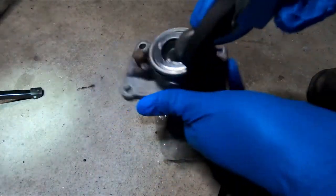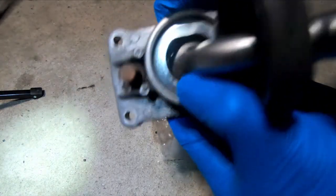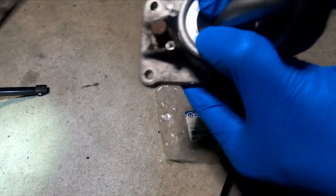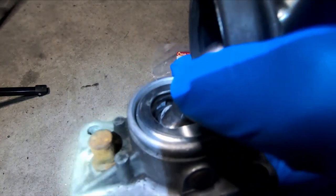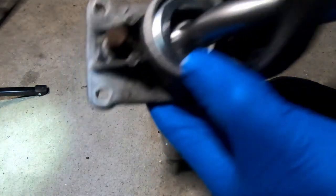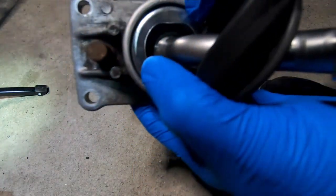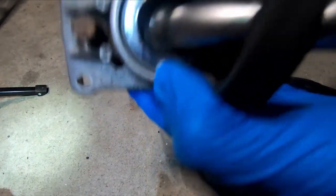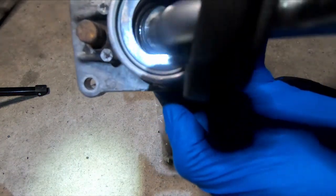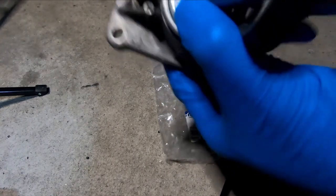I was able to get the shifter locked into place. When you put the shifter on the housing, press down on the ring spring and turn it until it locks into place. It's hard to see on camera but you can see the pin is lined up at the correct end of the slot so you know it's locked. Another way to verify: the ring has two straight lines on each side — make sure those straight lines are parallel to the housing. That's how you know you've got the ring all the way to the lock position.